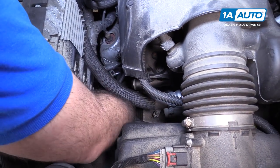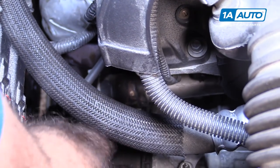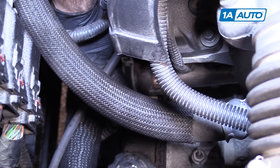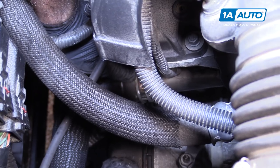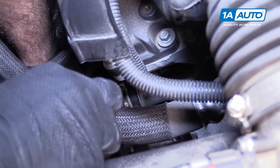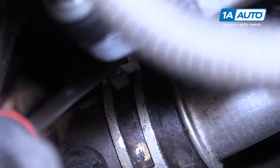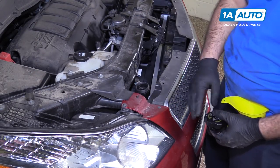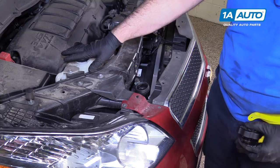Reinstall the lower radiator hose to the engine. Put that right into place — it'll go on right to that little stop. Get the clamp roughly where it was, take a flat-bladed screwdriver, and pry it down. It's snapped into place and it's sealed up. Remove the radiator cap. We're going to fill this system at the radiator. You could fill it through the overflow bottle, but it would just take a long time to fill.